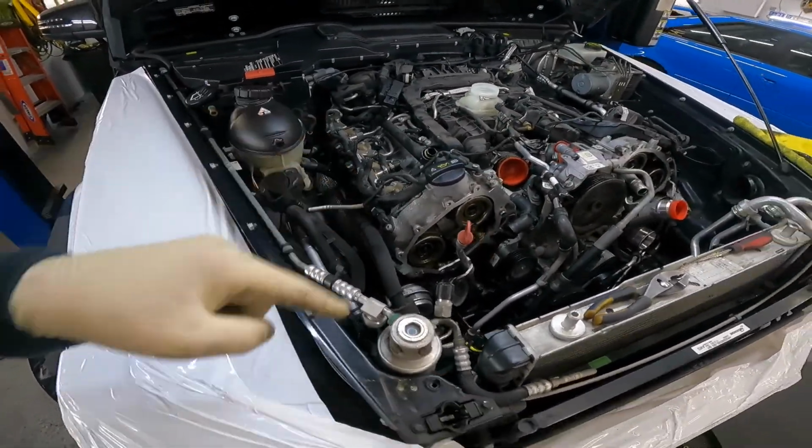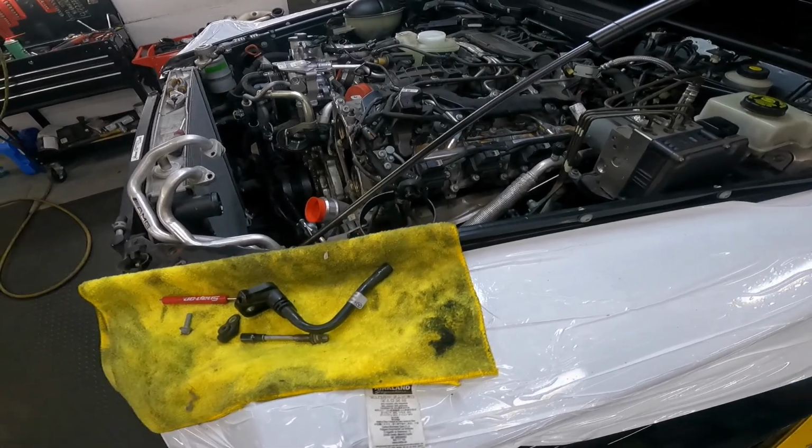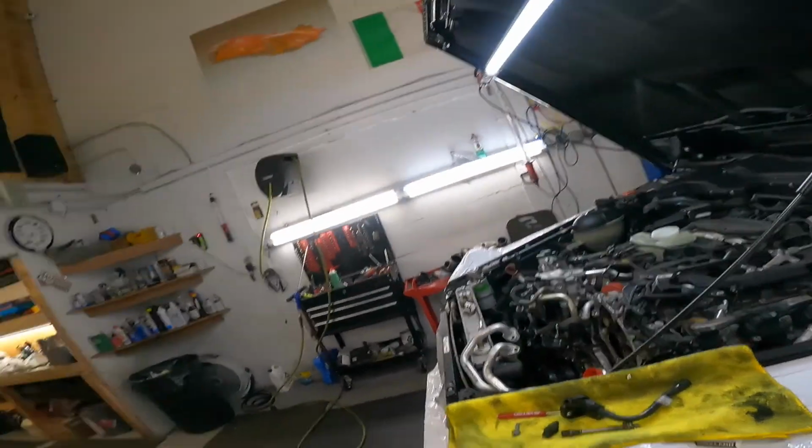Then we replace spark plugs. I'm sure they installed Bosch, but I wanna switch to NGK. NGK is our favorite spark plugs. All supercars, sport cars use that. And Bosch, we have so many problems with the Bosch on that M157 engine. We have a few of them where just that electrode is jumping and blocks the spark, and of course it causes misfire. We went to NGK. NGK, you're the best for boosted car and for regular one.